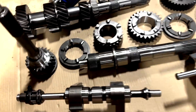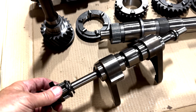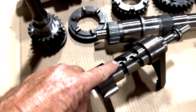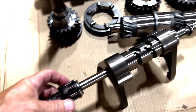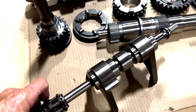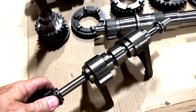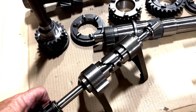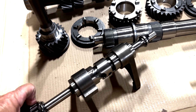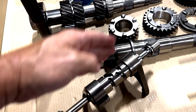The shift fork on the PPG is pretty elaborate. It looks very simple, but it's got these little circuit cuts out here. This is the piece that the lever pulls on — watch how they move — and that controls the sequential action. I'm just simplifying it here, but you can see how that just pulls it in and out, back and forth, to go from H-pattern to sequential.